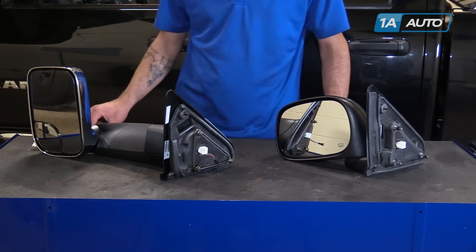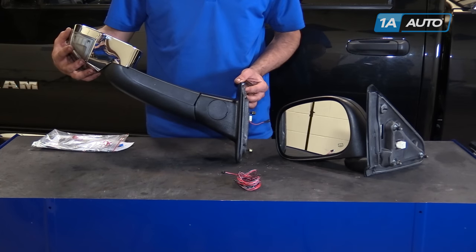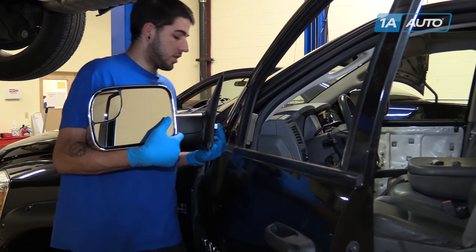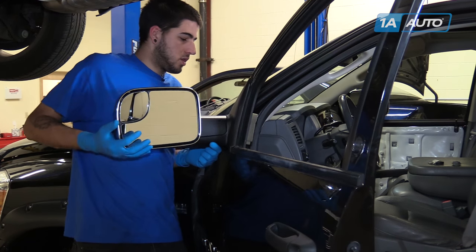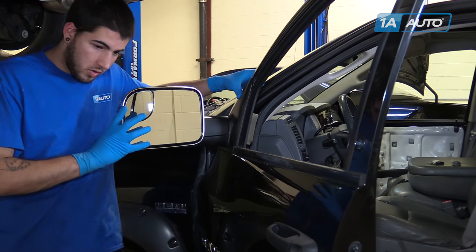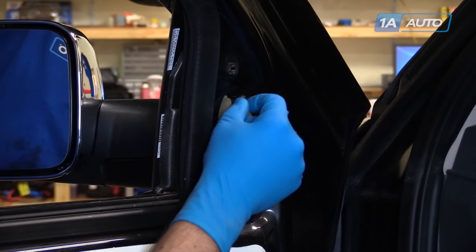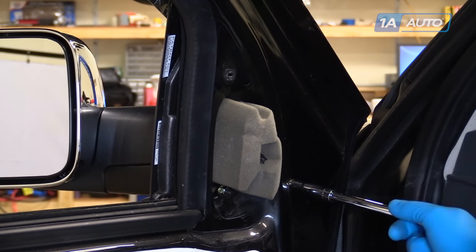The mirror comes with an easy-to-install two-wire harness so we can use this lamp as either a turn signal or a parking light. Be sure to take the two-wire connector, feed it through first, line up your bolts, and pop the new mirror in. Make sure you use the new hardware supplied with the kit, as it has a larger flange on the nut to help support the extra weight of the bigger mirror. Tighten the bolts back up with the 10-millimeter socket.